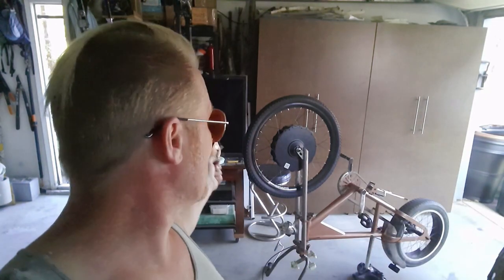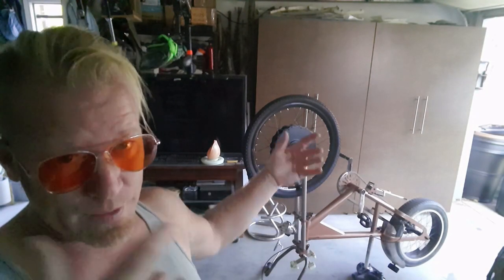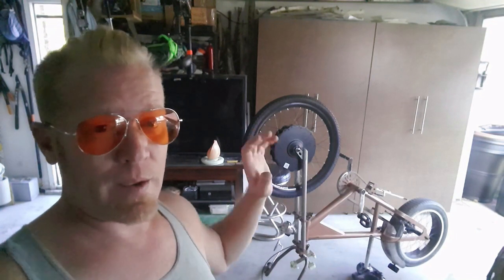I can report this wrench worked actually pretty well — I'm feeling that the tire is in there really securely. If you want to use your own wrench to really tighten it down, I would recommend it if you feel that's necessary, because the only thing holding this hub motor onto your bicycle are those two nuts on the outside — make sure you are comfortable that everything is nice and secure before you start riding. At this point, if you have a front brake, now is the time to install it — be it a disc or a V-brake rim grab. I don't have a front brake on this bicycle, so I'm going to skip straight to flipping it back over, getting it on its kickstand, realigning my mirrors, and then moving to the next step of installing the app and doing the calibration phase.